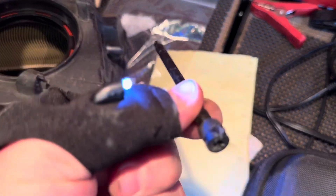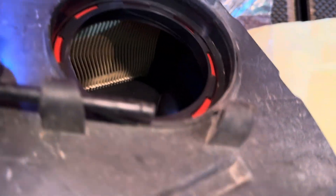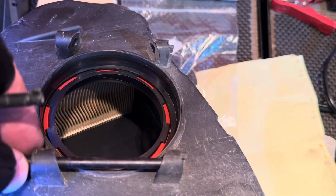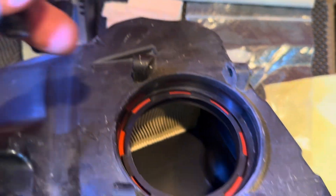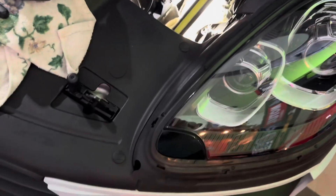The tricky part is these plastic retaining rods that go in and only turn 90 degrees - it's a T30 Torx. There's a little tab and you have to turn it outward to lock it in. You can see underneath how that mechanism works. Pulling them out was not as easy as what they indicated in the tutorial - I ended up having to use a fairly good set of pliers to grab onto the top of these things and pull them out. They say it's kind of hard to put them back in too, so I'm a little nervous about that.